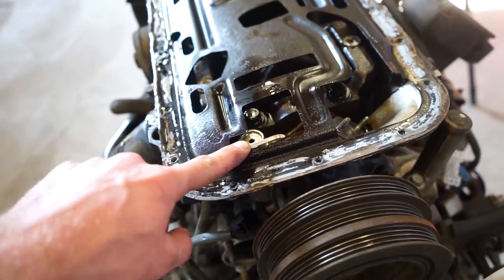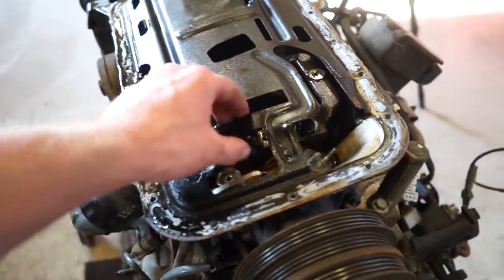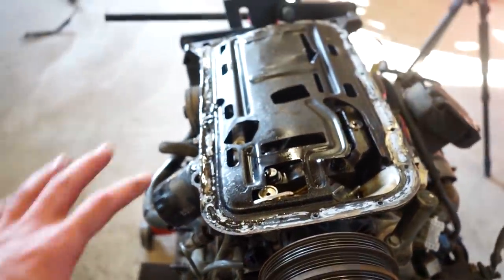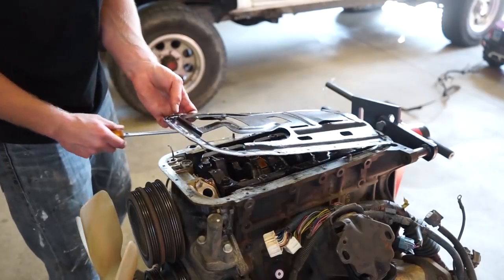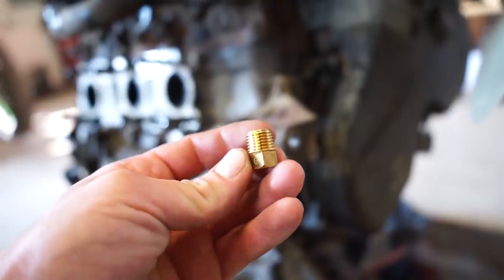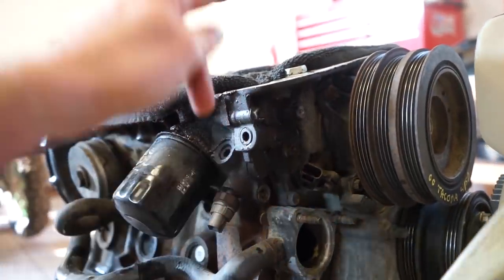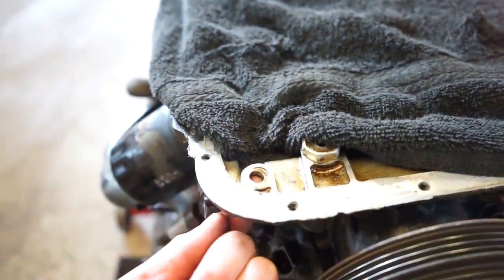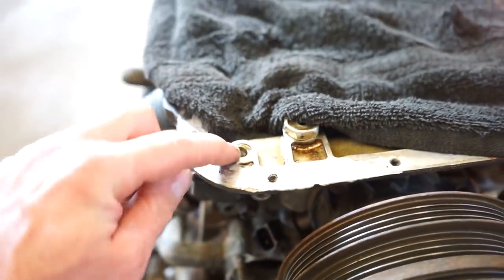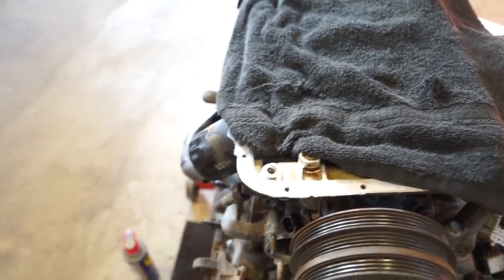Pan is off. You can see where this dipstick comes in and just hits this plate — the pan is only about an inch thick right here, so that's why we're relocating it. We've got to get this whole plate off, punch out the factory dipstick, flip it back over, seal that hole up, and then get the drill in for the other hole, which is going to come through right here. This is a quarter-18 pipe plug and this is the hole we're going to be tapping. I'm going to leave the motor upside down so there's no chance of metal shavings going in.